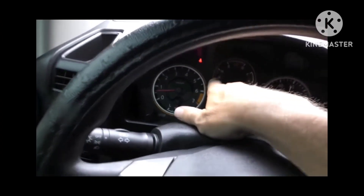After about 40 minutes sitting with a portable fan simulating the missing condenser fan, the vehicle is certainly not overheating anymore. The soldier who owns the car is pinching pennies, so Scotty tells him to go to AutoZone or O'Reilly, get a generic electric fan, mount it there, put a toggle switch in the dash with a 20-amp fuse so you can turn it on in traffic and off on the highway. He mentions the wreck might have even damaged the computer controlling the fan.